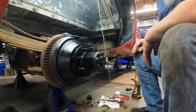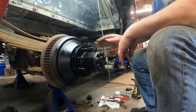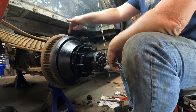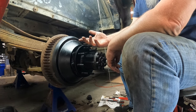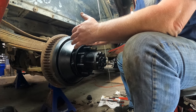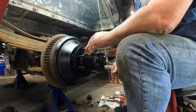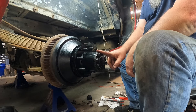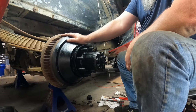Alright, those are all torqued now. Just roll this guy backwards a little bit and get the pry bar out. The only thing left to do here is get in here and adjust the spread on the shoes to make sure we've got a little bit of drag. There's a little window at the bottom of the backing plate - you can stick a screwdriver in there and hit the little star wheel on the adjuster to push the shoes outward. You just want a little bit of drag - not a whole bunch, just enough to where you can kind of hear it dragging. There's a not-round spot somewhere on this drum because we get easy slight drag then big drag, but that gets us close enough. When we go to bleed these, that'll take up the slack.